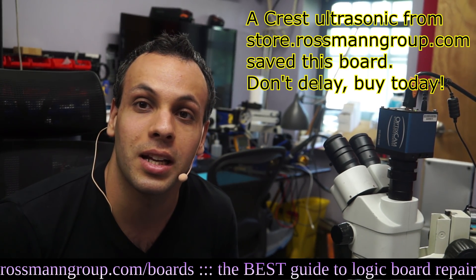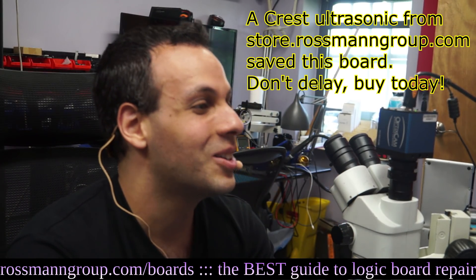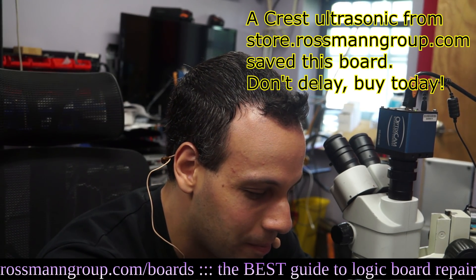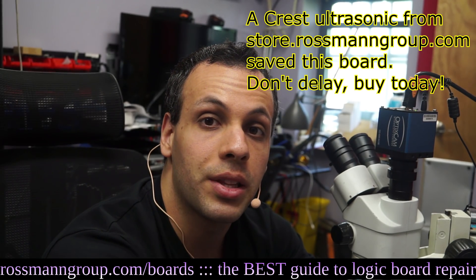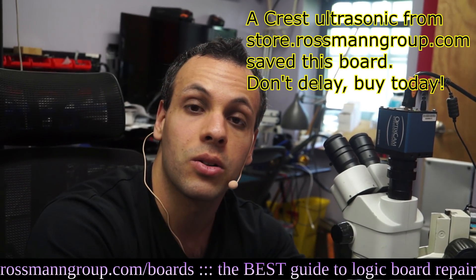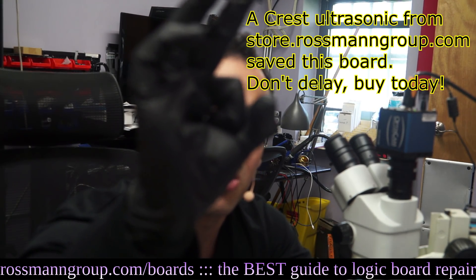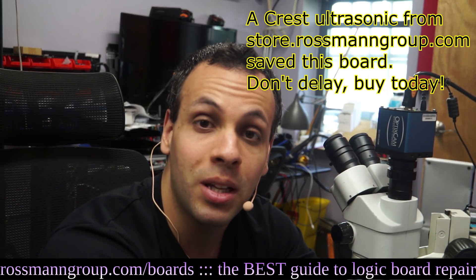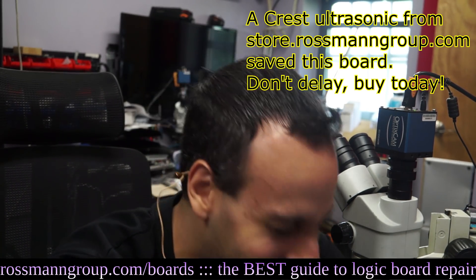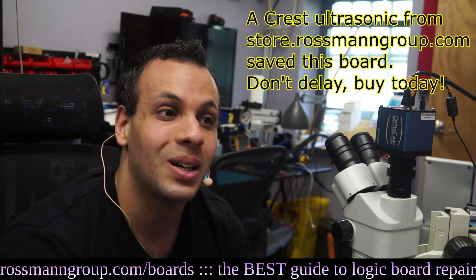That's one of those things to think about before you spend $1,299 on one of their products. That is so sad. Engineered in Cupertino, California. Can we even call that corrosion with how small it was? You can see that I removed every bit of corrosion from the board — the argument will be, well Lewis, there was corrosion there. We went over the board with a 45x microscope. We removed every piece of corrosion and re-soldered any connection that had even a trace of it. In my experience, that much corrosion is not going to do it. Which means what was causing this to not work was probably not the corrosion — it was the dust. I'm going to be paying my rent here for a long time into the future, I can tell.